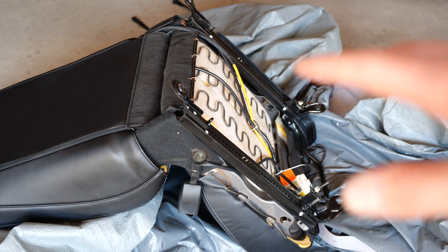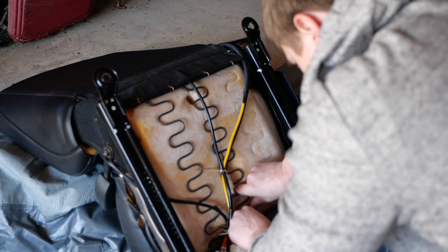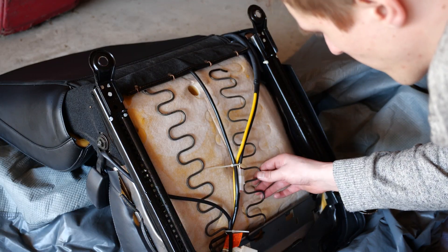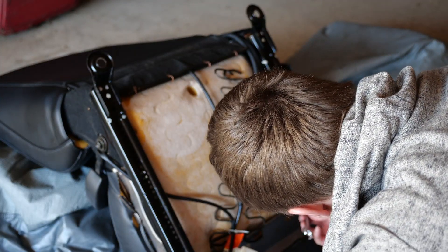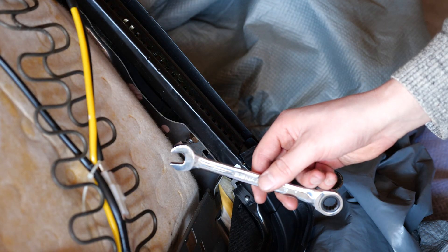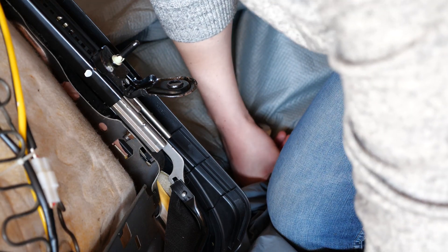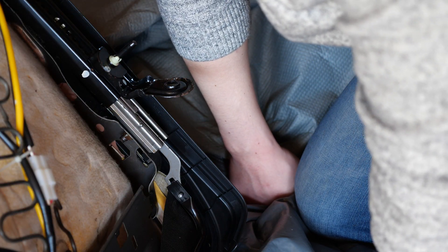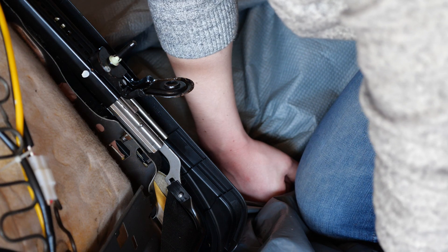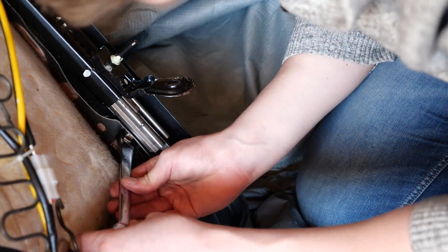My car cover is now the workbench — I don't want to put the seat on the floor. Next step is moving these spring supports out of the way to get to the bolts underneath the sliders. They're just hooked in top and bottom. Next step is loosening the bolts to get the seat rails off. Although the instructions say 12 mil, mine looks like a 14. The nuts holding the seat rails onto the seat are really soft and done up stupidly tight — you can actually see the metal bending.